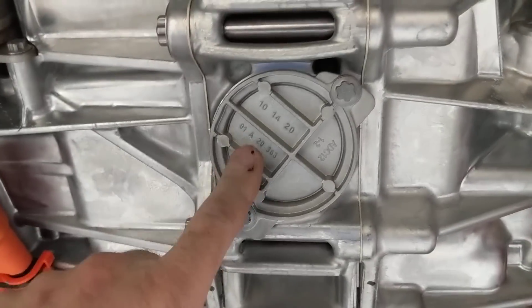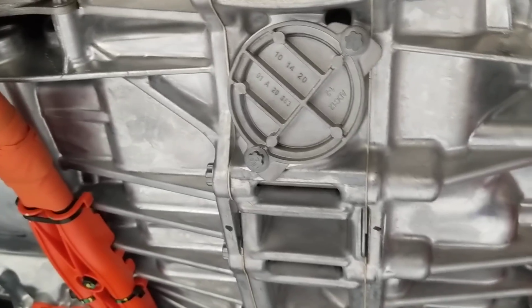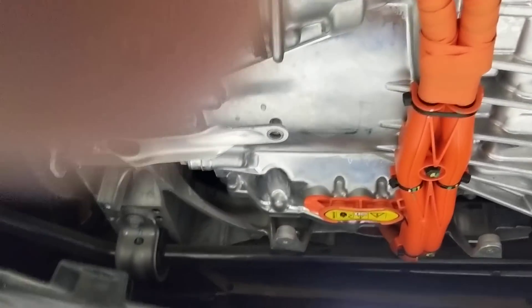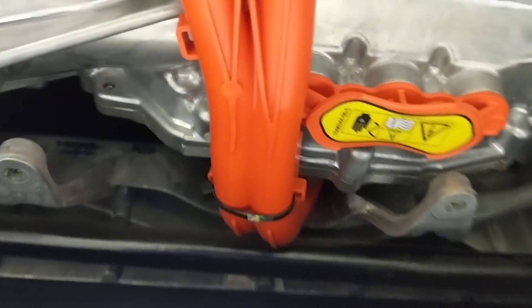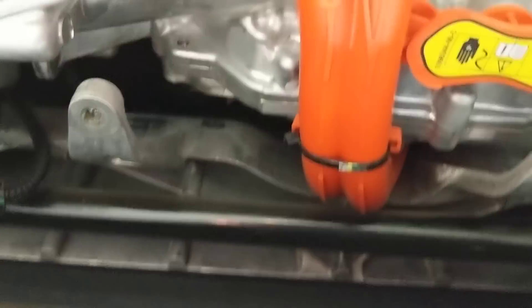This cover probably contains the oil filter or screen for pickup. This does not have a differential — it's just two gear reductions. Internally they have this carbon-overwrapped rotor that does a gear reduction directly to the half shaft, so it's symmetrical down the middle. The inverters at least externally look identical to the ones used in the 3/Y — same casting — so I would be surprised if those weren't a carryover. SiC FET based.